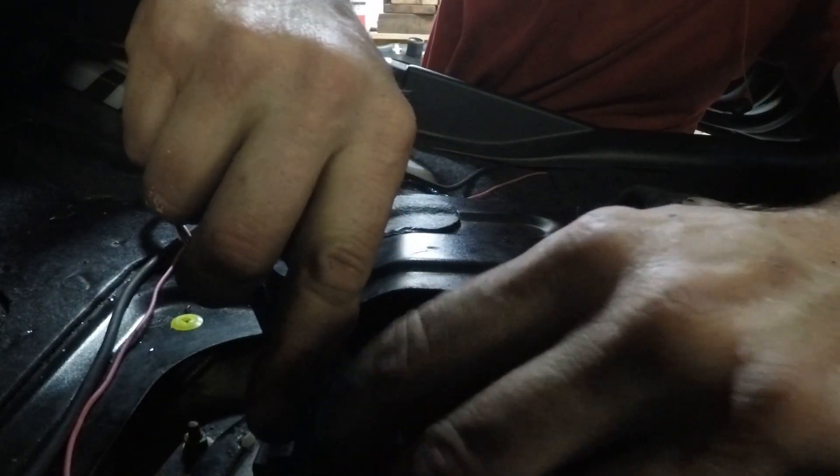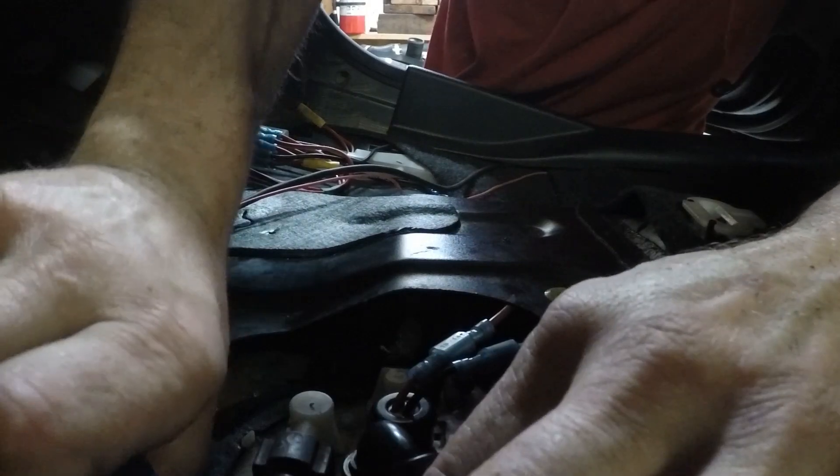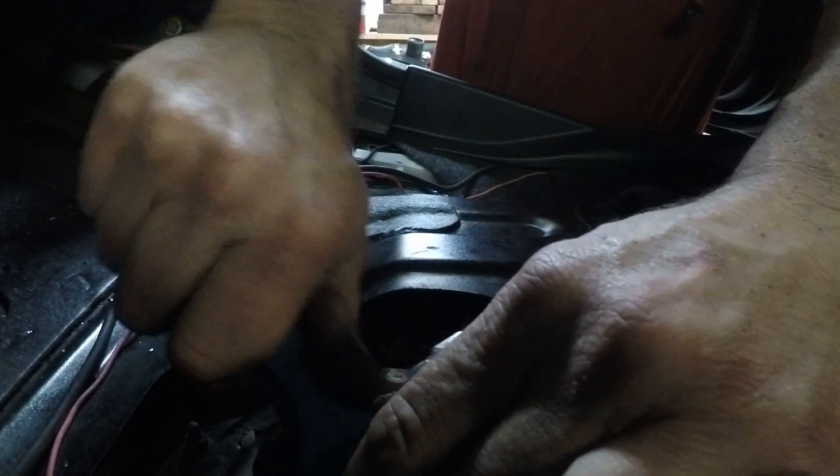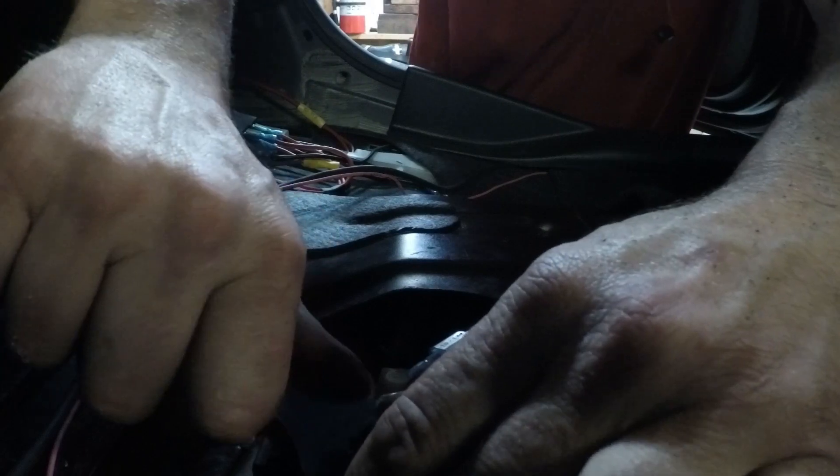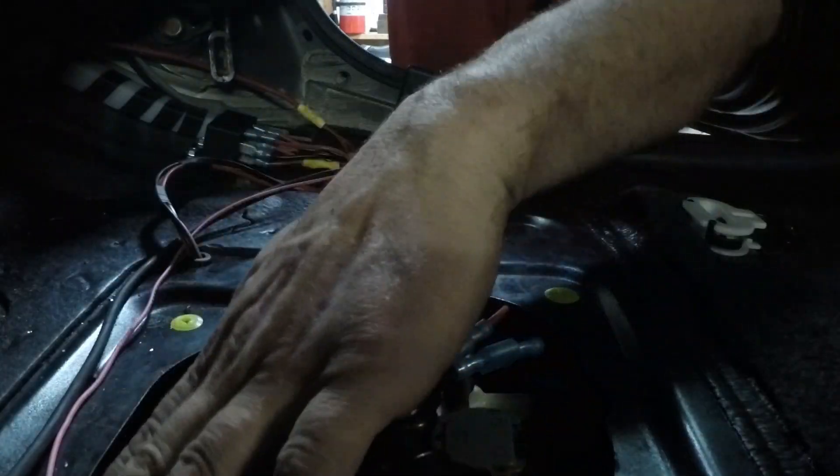There's our fitting — I had to fish it through that rat nest. I have a little extra slack here and it's kind of pushing down on the line, so I want to bring it up a little bit further. I'll loosen this fitting up at the top and drag some slack around — there we go. With these fittings it'll twist in the actual double pumper pump housing, so hold the end of it and you can get it good and tight. That is the back half of our pump — we've got our primary and secondary lines all run.